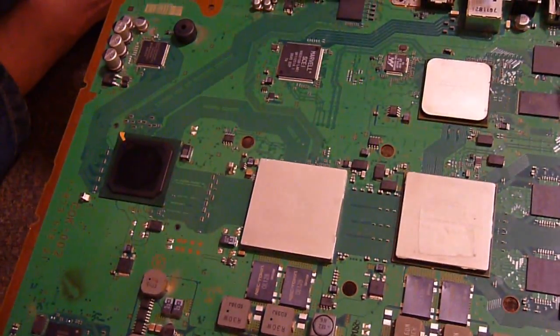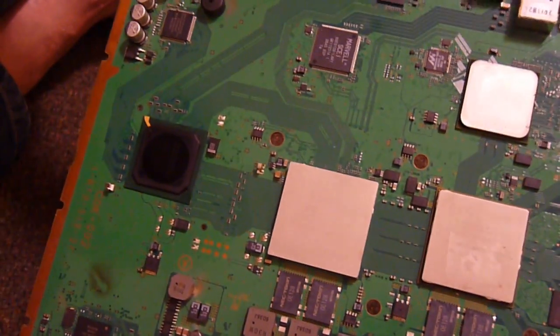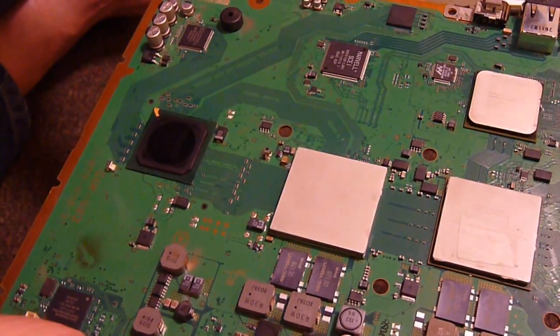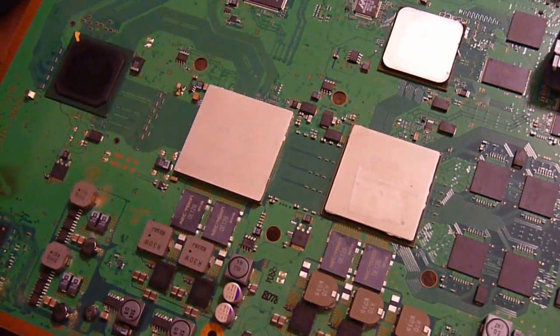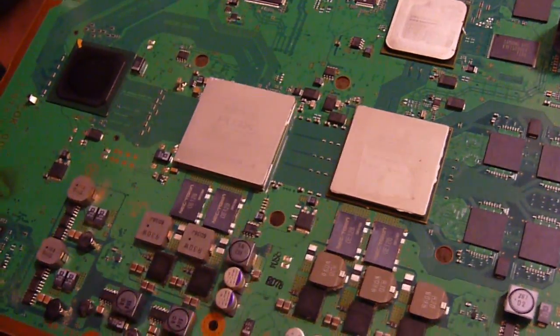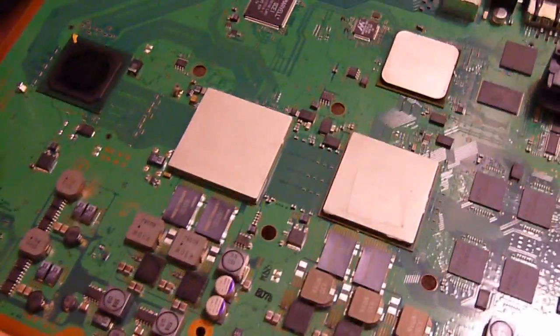This chip comes once again from the mysterious PAL chip that's only found on PAL ones. The interesting thing is, on the back of these two chips is actually GB, so that's probably referencing the region, actually. Those caps look suspiciously bulging. I'll pop them under the ESR meter, maybe. Or maybe not. But yeah, quite a lot of power regulation.